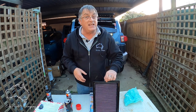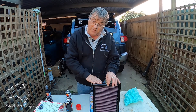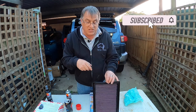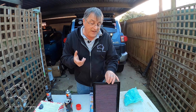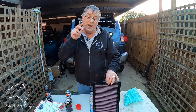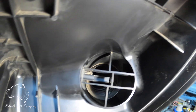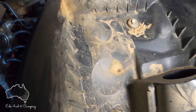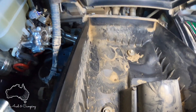It's all red on that side, so it looks like it's been spread on evenly. I'm going to pop this back into the air box of the FJ. Now, remember how grubby it was — I used to use paper filters, but a mate of mine said give this a go to stop the dust getting into your intake. It did about three and a half thousand kilometers on nothing but dirt and dust. Let's go have a look at the air box and the intake. I'm fairly impressed with how clean it is. That's where the dust got drawn in from the snorkel.